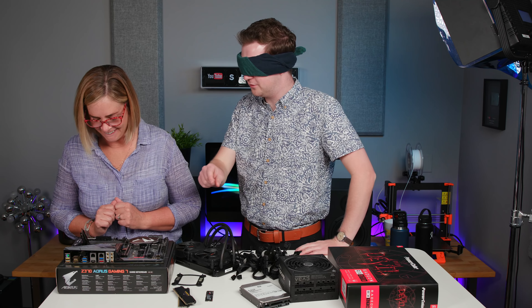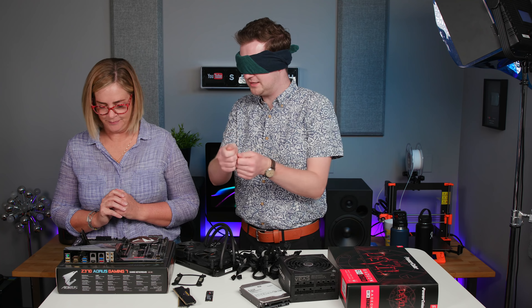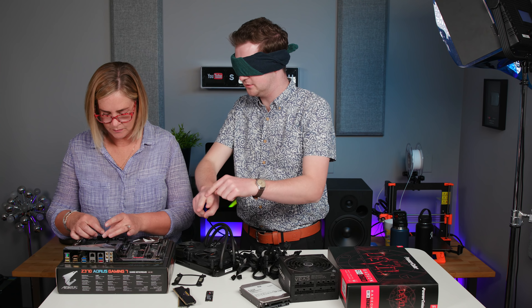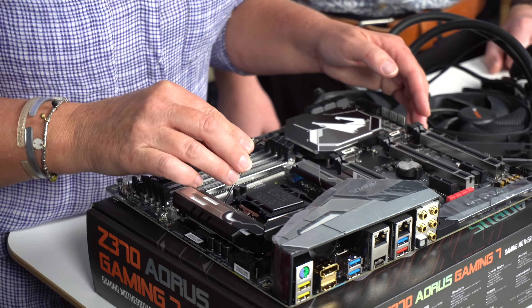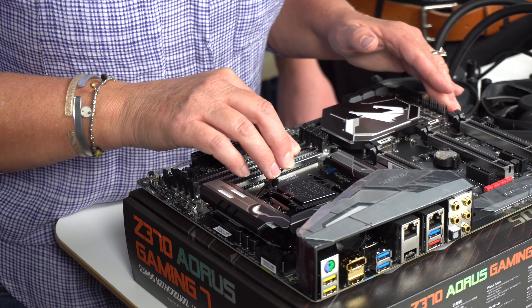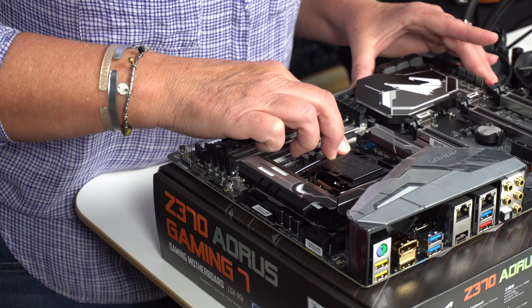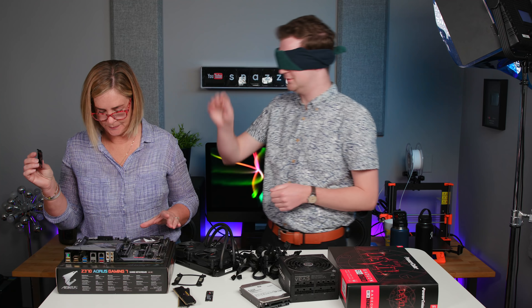Take that same arm, lift it down, and make sure the little knuckle at the top of the bracket goes underneath the screw in the middle, then push it down. You're going to have to apply quite a bit of force — don't be nervous. The little black thing just came off. Pull the black thing off and everything's good. You just installed your first CPU.